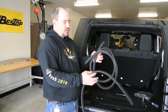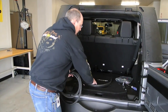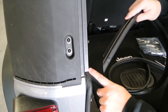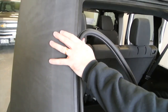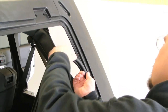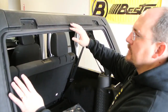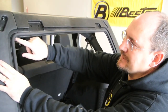Your Trek Top Pro kit comes with two weather seals: one that goes on the bottom of the rear glass back window, and one used for attaching to the halo to provide a weather-tight seal. To install the halo seal, make sure that the angle cut matches to the Jeep. Start at the bottom and work your way about halfway up on both sides before you do the middle. It's important you start on the ends and then go to the middle towards the corner — that's how you make sure it gets nice and tight.